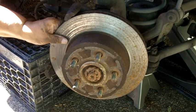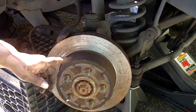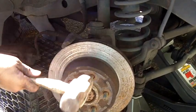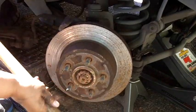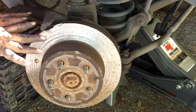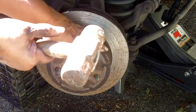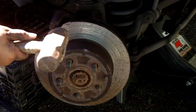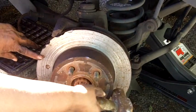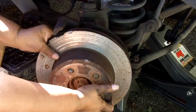My rotor is not going to just pull off — I'm going to tap it a few times around to loosen up some of that rust. I freed it. Sometimes it's best instead of tapping lightly around the hub to get better leverage by hitting further away — tap further away and it will pop this side out. I had to really hit it hard to pop this rotor off; you may have to do the same thing. Then once you get it to that point, it just lifts right on off.